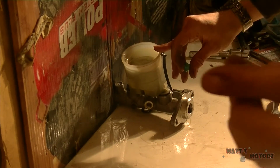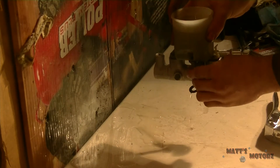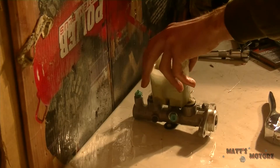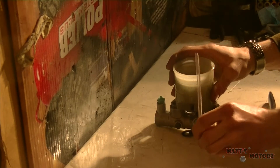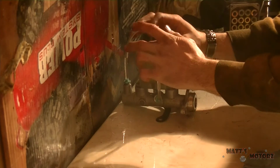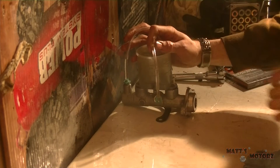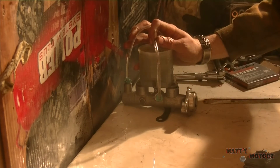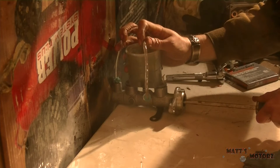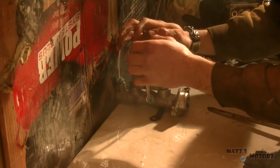These little green fittings have a little port at the end — screw them into where the lines go in. One goes right here and the other goes up here. You don't need to super tighten these since they're plastic. It also comes with little tubes that connect onto these fittings. It's important that you keep these tubes submerged. Don't let the master cylinder run dry when you do this or you'll have to start all over. Take a screwdriver and just push in about halfway, then wait for all the air bubbles to come out.